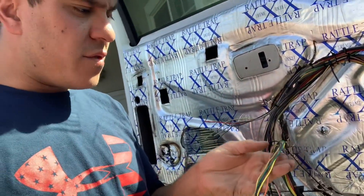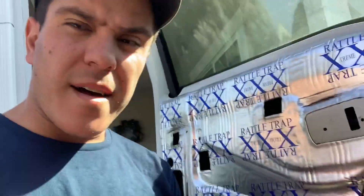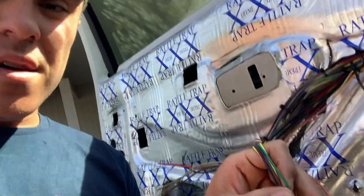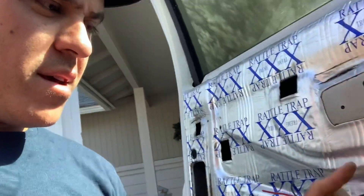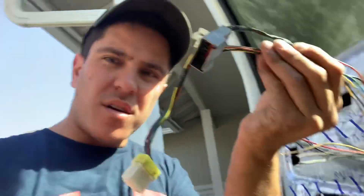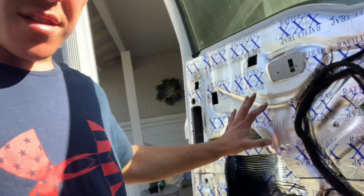The driver's side adjustable wiring is already taken care of in the harness. Looking at what's left over: on '02 to '07 the green-orange is your 12-volt; on '99 to '01 it's green and yellow. All other wiring is the same. You've got yellow for the common wire, purple and green for up/down and left/right. We just need to splice in the two power wires and the three adjustable wires, tape it all up, and move inside the truck.